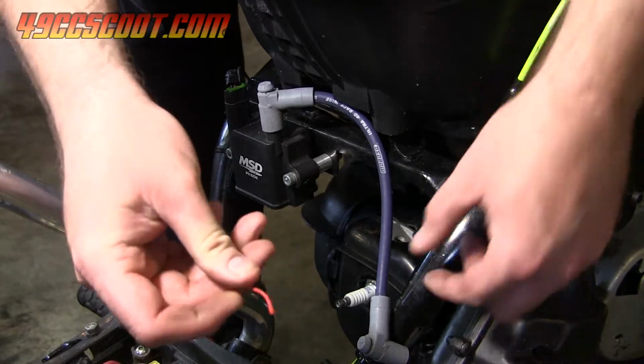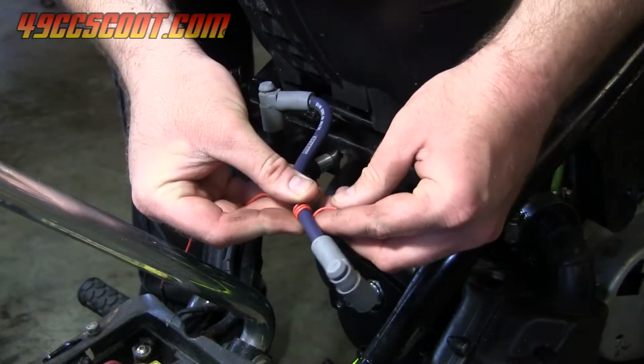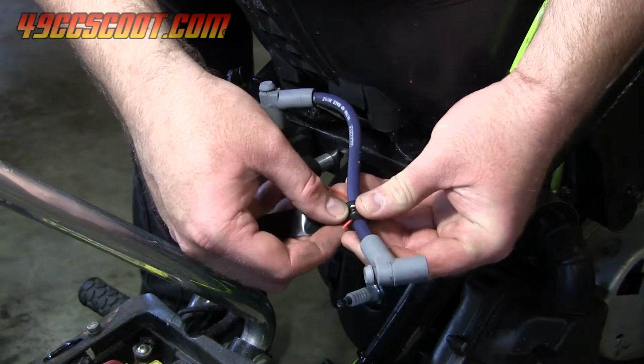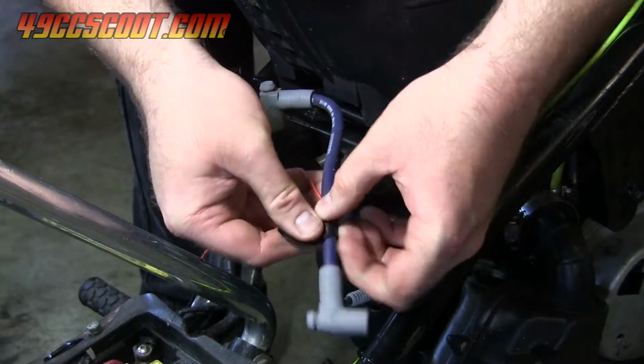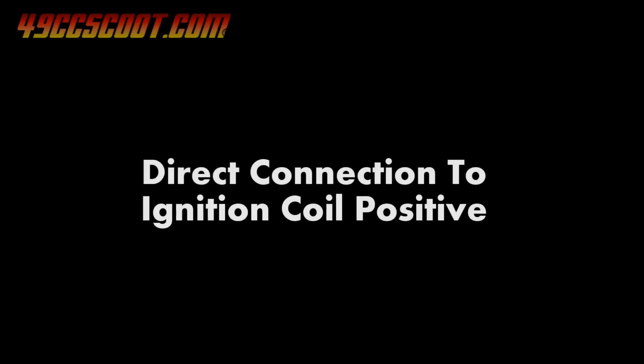The tachometer only uses one wire to pick up a signal, and it can be installed a couple of ways. The fastest and easiest way is to wrap the end of the RPM signal wire around the spark plug wire. Trailtech recommends 5 times around as a starting point. I use electrical tape to secure it around the plug wire. I chose to connect the RPM wire to the wire leading to the positive side of the ignition coil instead. I think it makes the installation a little bit cleaner.